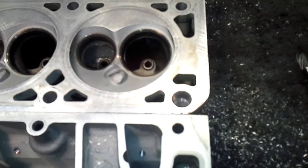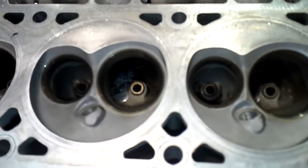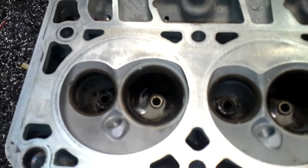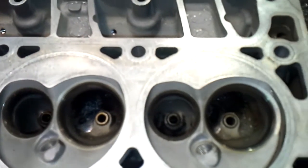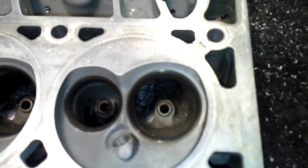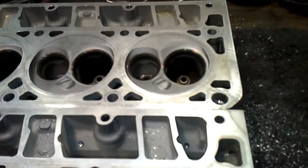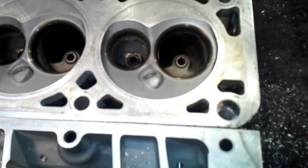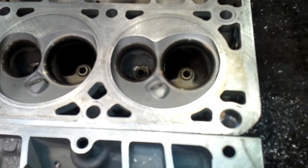I just wanted to do a real quick video as I was working these heads, just kind of showing the process of removing that swirl ramp. This is just one step in the process with one burr, and a lot more to come. Once I go to a smaller burr - probably a three-eighths burr - I can really get in there and do some shaping to that guide boss that the half-inch burr can't reach. Anyway, 241 heads in process - hopefully this makes sense to you guys, and is something you can look for when you look at ported heads or want to make changes, and how to do it safely. Thanks for watching.